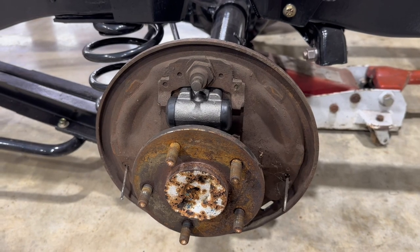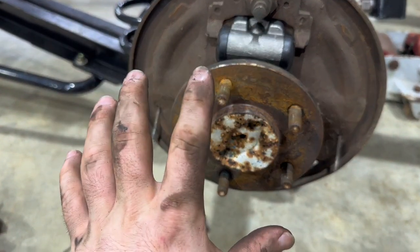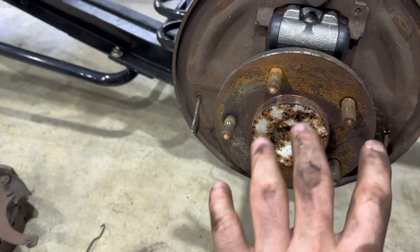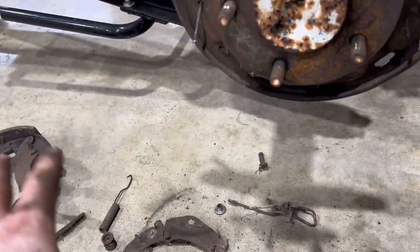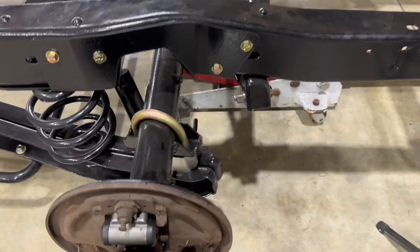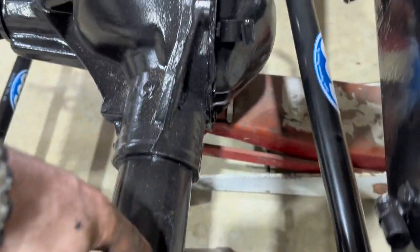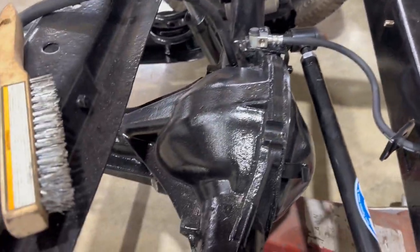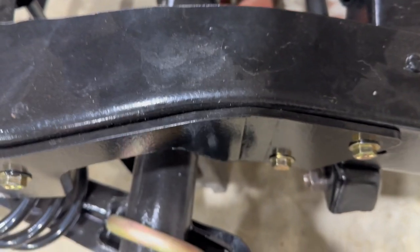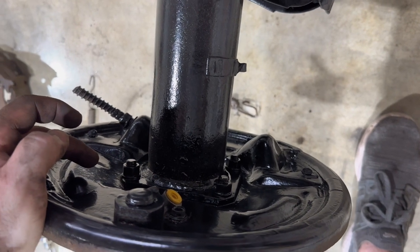I have the left rear wheel taken off and the new wheel cylinder put in. I'm going to hold off on putting the brakes back together on the rear just because the shoes are actually in great shape, so I'll probably clean that up and reuse that stuff. We need to run the brake lines from the wheel cylinder across the axle and up into the distribution block, and the same thing on the other side. It's going to be two fittings, one per end, and we're going to need to do that double flare.